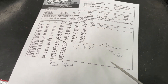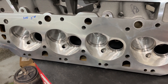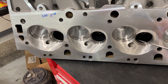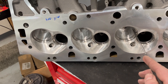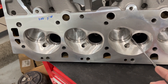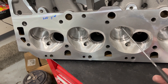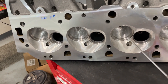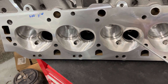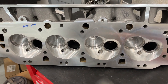Overall, these are definitely things you can do yourself. Go to a machine shop that has some idea of what they're doing with airflow and get a five-angle valve job done. Then you can easily do this work: bowl it to 2.20, throat at 91% — take 0.91 times 2.25 and you'll have that number — then widen and lay back your short side, and just blend in the valve job on the chamber. Besides the valve job, which you'll likely have to pay someone to do, that's it and you'll be golden.